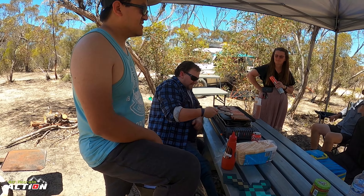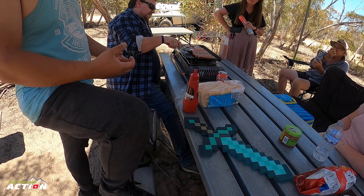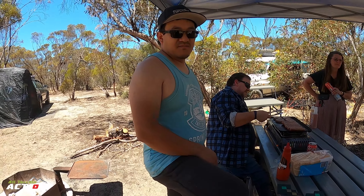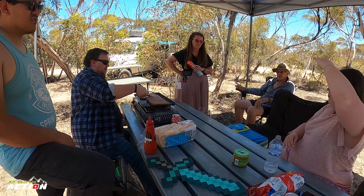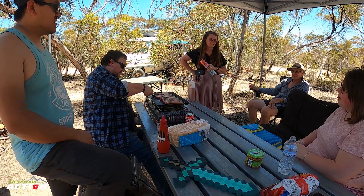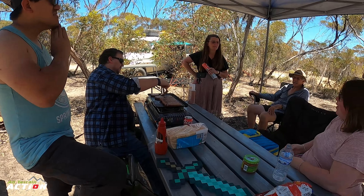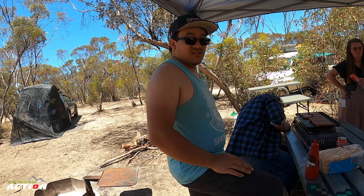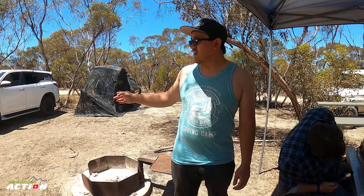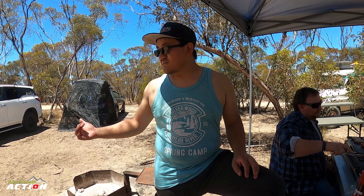The wider the tyre, it all works on footprint size, but it's also capacity as well they said. I'd be probably 15, 16. It was higher than it should have been. The tyres would be cold now. I'm like, that is not legal. You're saying 15 hot - 15 hot. So when you start and they say wait until your tyres warm up, you should avoid turning. I'm going to start at 15 cold. It's only a couple of PSI - we should be 17 probably, 18-ish.